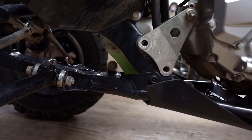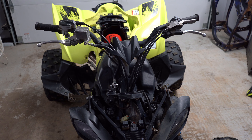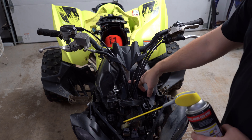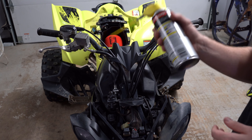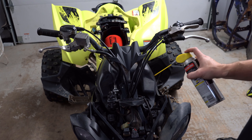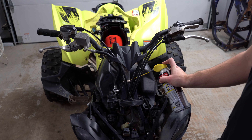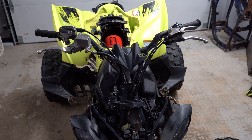Last step in the ready-to-ride was to check the coolant level, and this one's good so we won't have to add any. Walking around the bike just to inspect anything we noticed wrong. Whenever you move your handlebars back and forth, the YFZs have these two O-rings. It'd be best to take them apart and grease the whole thing, but you can get by with just some gel lubricant. If the customer's not ready to tear the stem out of the bike, just spray some gel lube around there after your wash, work it in, move it back and forth, and that'll stop most of your squeaking.